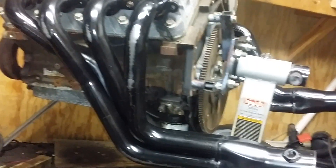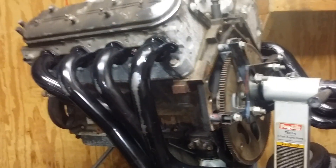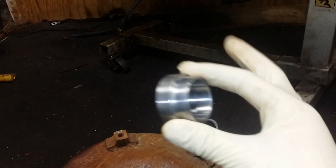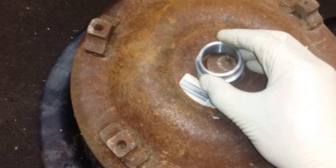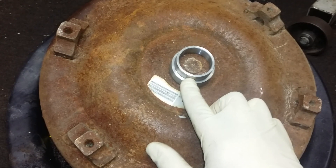To adapt an older style trans to a newer style motor with that flex plate — it's got a little dish to it — you don't need to spend money on the flat flex plate, special torque converter, or that stupid bolt-on adapter GM uses. All you need is this big centering ring bushing. Hughes makes it, PRW makes it, Pace Performance sells it. I got it from Michigan Motorsports for $22.